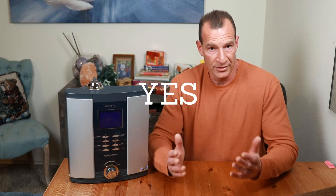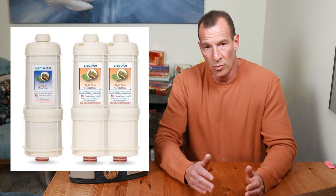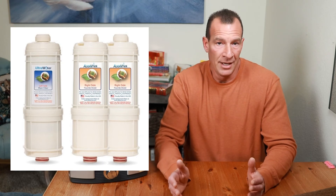So the answer to the question — does a water ionizer remove fluoride — is yes, but only if you have a fluoride shield filter inside the machine. One thing to keep in mind: although the normal pre-filter and the ultra-water filter are both 1,000-gallon capacity filters that change approximately once per year, the fluoride shield only has a capacity of 500 gallons. So if you're using the fluoride shield, you'll have to change that filter twice per year to keep it effective, because the media can only remove fluoride for a limited time before it becomes saturated and loses its effectiveness. You can purchase those filters in a set, which comes with two fluoride shields and one ultra-water filter, giving you about a year's worth of filtration.